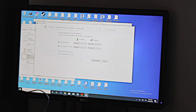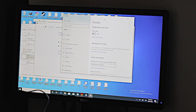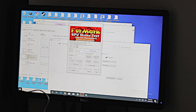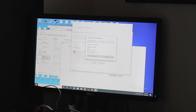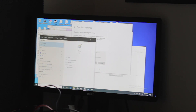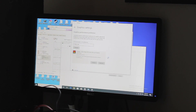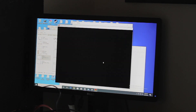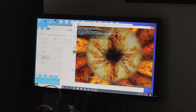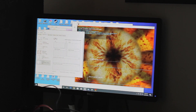Now with the lid closed and the internal display off, it looks like it's seeing one display — which is what I want. Let's give Furmark another test. In Windows 10 you can set which graphics card an application should run off of. After forcing it to use the R9 200 and relaunching the app — boom! That's exactly what I expect. Looking at GPU usage, we can see it's the R9 200 being maxed out now.